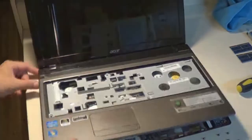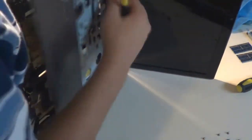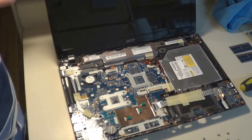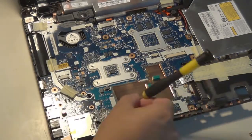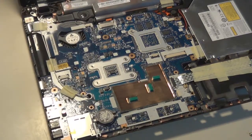And just make sure that you don't yank any other bits of plastic around, and that you make sure everything is unscrewed. It's real easy with these flimsy plastic laptops to leave a screw in or leave something done in, and it won't come out. There were some latches at the back, I think, that I just needed to wiggle around and it'll get it out. But anyways, if you leave something screwed in, or if you try and just be forceful with it, it's real easy to tear the threads out that hold the screw in, or tear the whole piece of plastic that has the threads in it, and then really ruin that bit of your laptop, so you want to be careful with that.